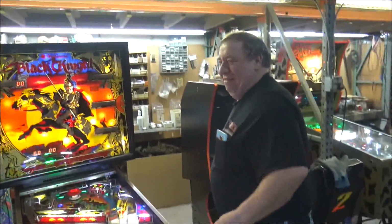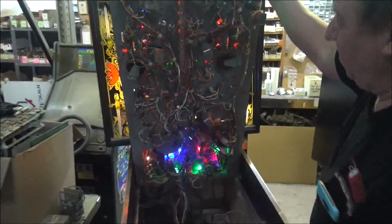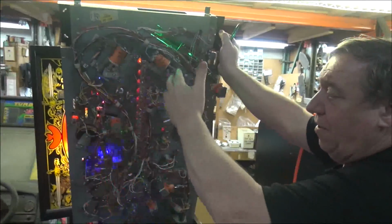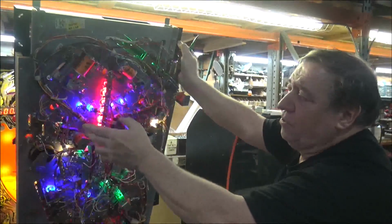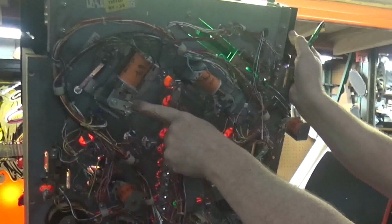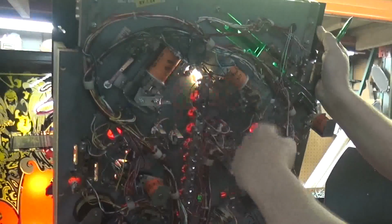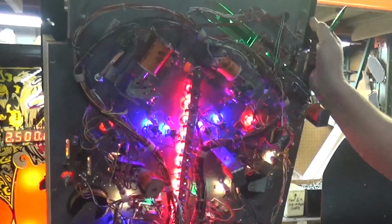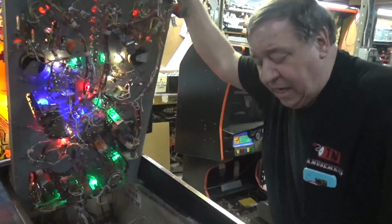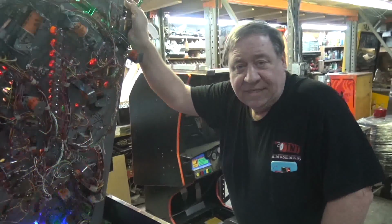You know where to put stuff. Now, all the flipper coils were shot. All the flipper pawls and switches, everything was shot. We took the brackets off, we scrubbed and cleaned them, we even had to change some of the white bushings. New coils, new end-of-stroke switches, new plungers and links on all 4 places. Sleeves on all the coils, okay? Because they were all getting gummed up and sluggish. And I do not know why, Jonathan, because this machine is only 37 years old.